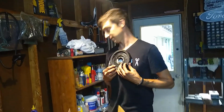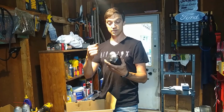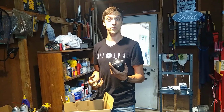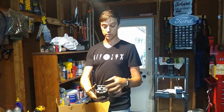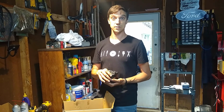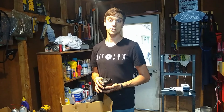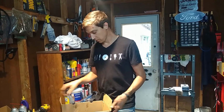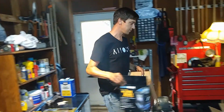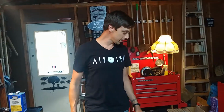Amazing. Oh, yeah. The coil: what I'm going to do with this is pull it apart, get all the guts out of it, and run external wiring from the primary and secondary circuits so that I can modify the 8N at some point to take a standard automotive round can coil style ignition. Long term though, not happening right now. I'm just going to keep it on hand for some custom modification.